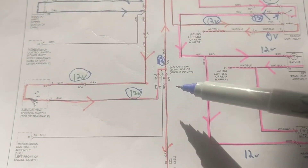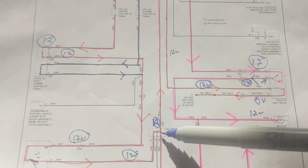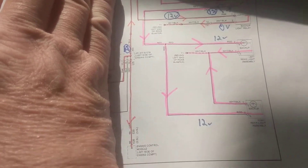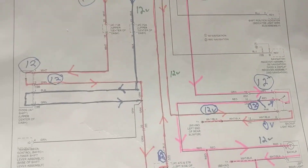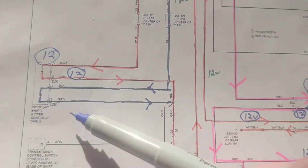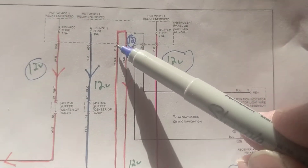The computer in this case really will not give 12 volts because it is already connected to the 12-volt line — it wouldn't make sense for the ECM to supply 12 volts when that source is already present. So 12 volts comes through either relay path, through the park neutral switch, back up through the connector to energize the relay coil.